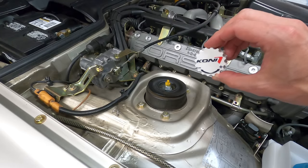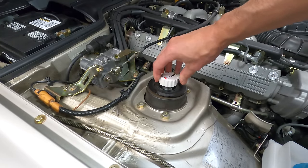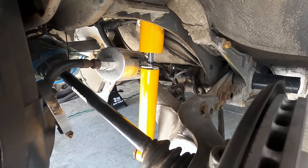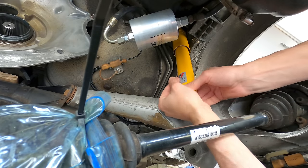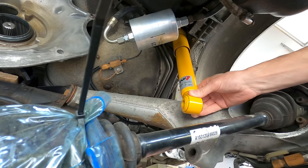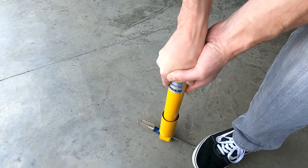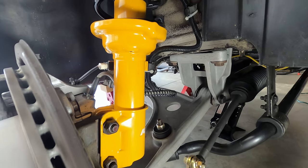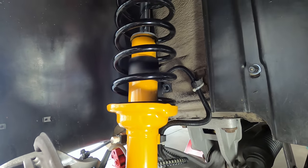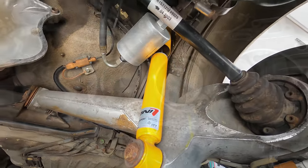This is where the level of effort flips between the front and rear — the front shocks are easily adjusted using a knob set atop each of the strut towers. However, the rear shocks need to be fully compressed and the piston rods slowly turned within the dust cap to change the damping. This procedure can be performed on the car by removing the lower mounting bolt, pushing the shock up, and then turning it in place, or by fully removing the shock from the car to compress it. The internal rubber bump stop does need to be removed to fully compress the shock units for adjustment. I've had both my front and rear shocks set to the softest setting for regular street use since installation, and I've enjoyed their performance so far. And best of all, Koni's come with a lifetime warranty.